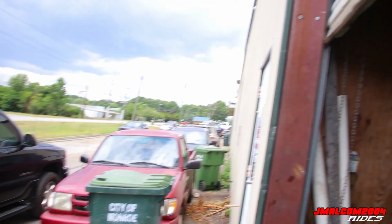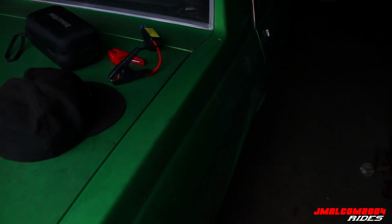it says run the engine three to five minutes, then recheck the tension on it. You check it while it's hot, let it cool, go back and retension the belt. So you gotta do all that. So yeah, I'm finna run this stuff to AutoZone and drop the battery off. A little storm finna come through. I'm finna get out there before it rains, then get back to the shop and wait till they call me back. So y'all just stay tuned.